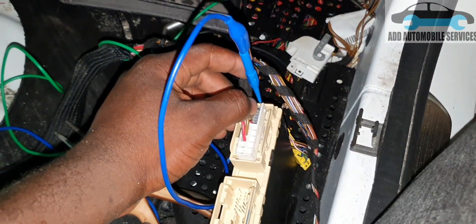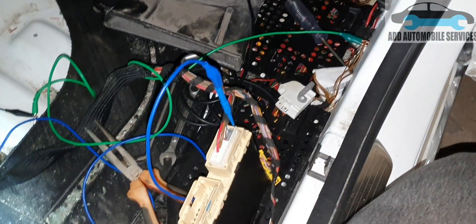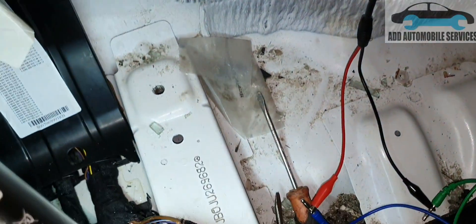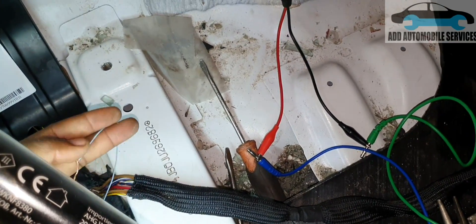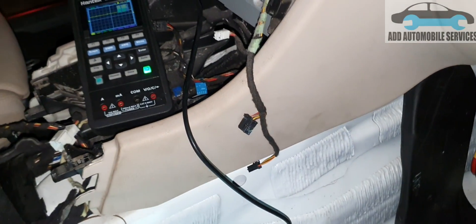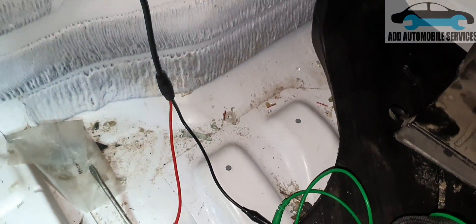I had set everything up but it lost connection with the pin. Now I can see I'm getting the voltage — this is a LIN bus network so I'm getting 11 volts. The scope is steady and there is no signal moving. You can hear the clicks from the unit and the communication line is working — which means it is a fix. When I disconnect this wire, the communication line goes off and there is no communication.